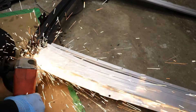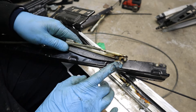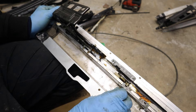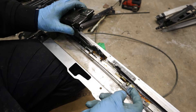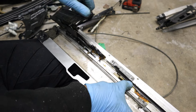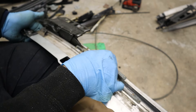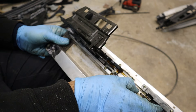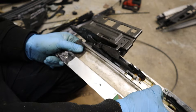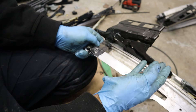This is why we're filming inside today — there's a thunderstorm in February. To free up the tilt mechanism, I'm going to remove some more rivets. There's a lot of adhesive here so I just opted to cut it off. Now let's take a look at the tilt mechanism. We have this little white hook here, which is directly driven by the sunroof motor cable, and that was going to hook up to this little lock over here. This lock is not allowed to press down nor press forward to adjust the tilt — until you go inside there, you'll see a little spring. That spring has to be pressed first forward, and then you can unlock downward. There are two tilt positions: as you move this over here, a little peg appears — that's the first lock position for the lower tilt, and as you continue moving back, it moves into the higher tilt with its own lock.